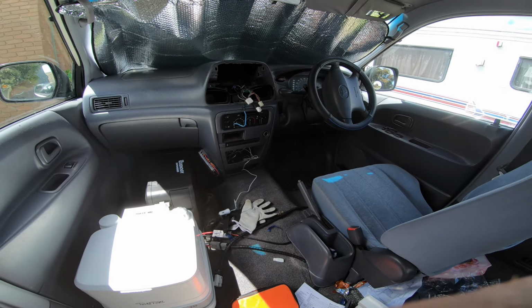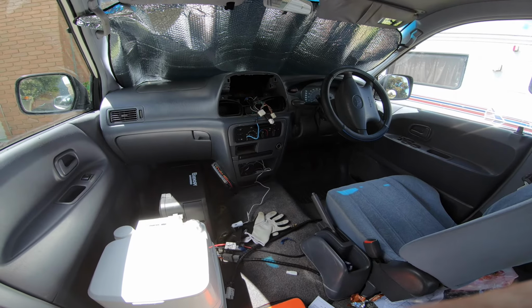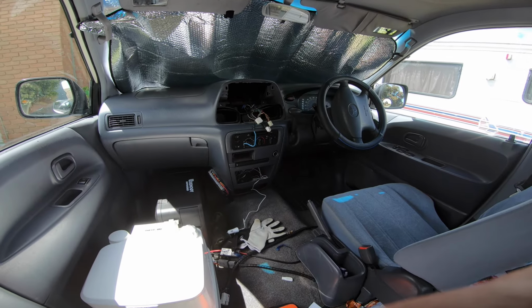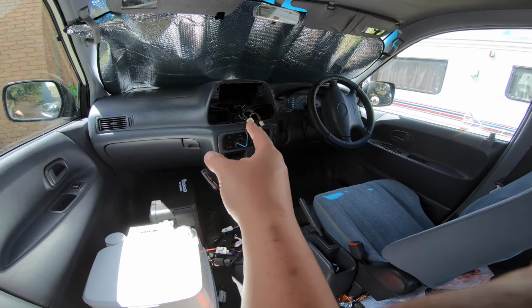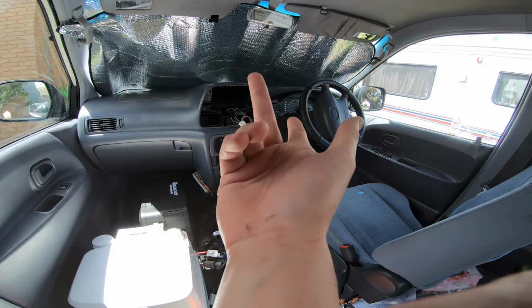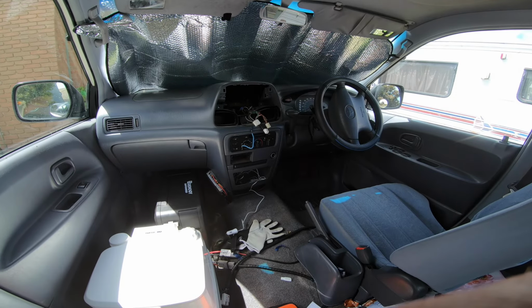I've just had the thing in pieces, pulling components off it, checking it. It's gone down to about 2 ohms of resistance, and it blows the fuse each time. I seem to recall when I had a Toyota Hi-Ace that it was negatively switched or did funky things with polarity. My Hi-Ace, like 20 years ago, blew up bits and pieces on me then.